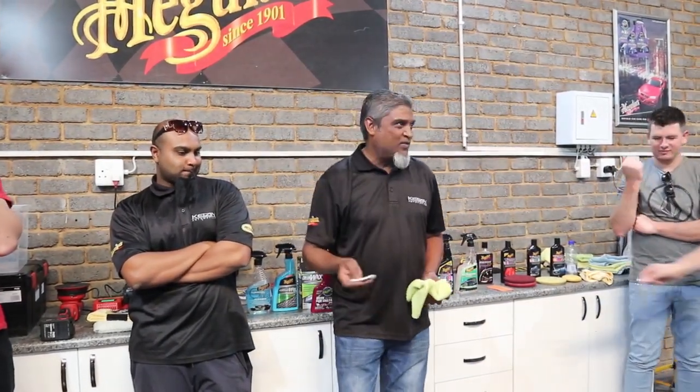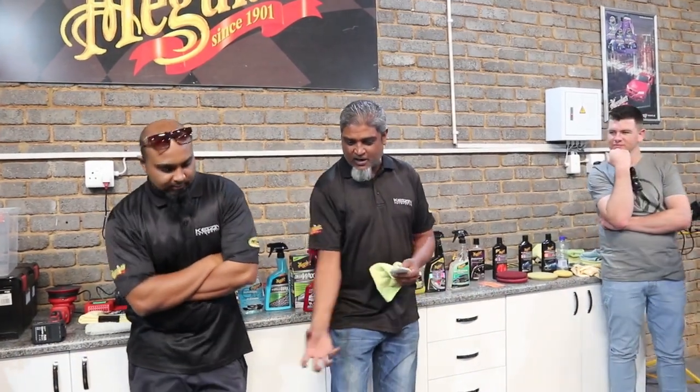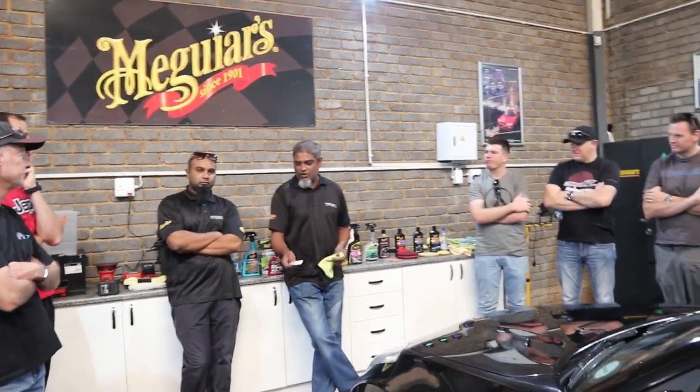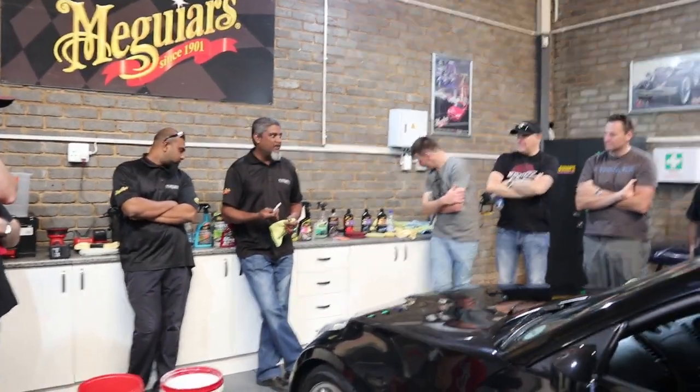Very important, do not drop it when you're working. Because if you drop it, what it's doing is it's sucking up all the dirt from the ground. And if you put that onto your paint, you're scratching instantly. So if you drop it, you've got to throw it away, unfortunately.